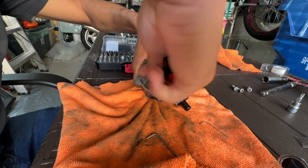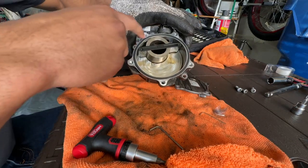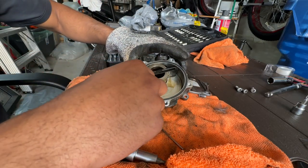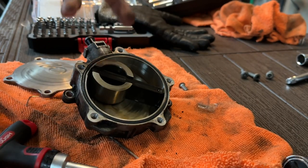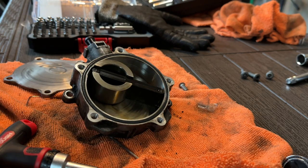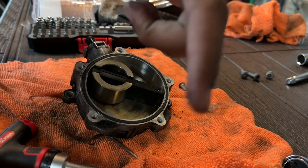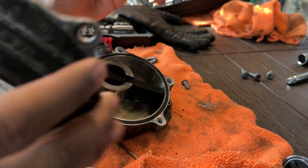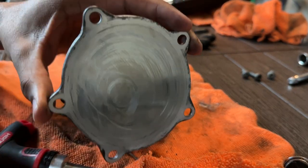There's a bit of oil in here too — we're going to dump that out. This black ring right here is the seal we have to remove. I'll take this allen wrench to pick it up and get it out of there. It looks like this kit does not include the rubber seal that goes at the back of the vacuum pump. So I'm going to seal this back up and replace the two seals in the front — hopefully that will stop the leak. I'll link the correct seal and gasket replacement for the 3-liter V6 in the description.